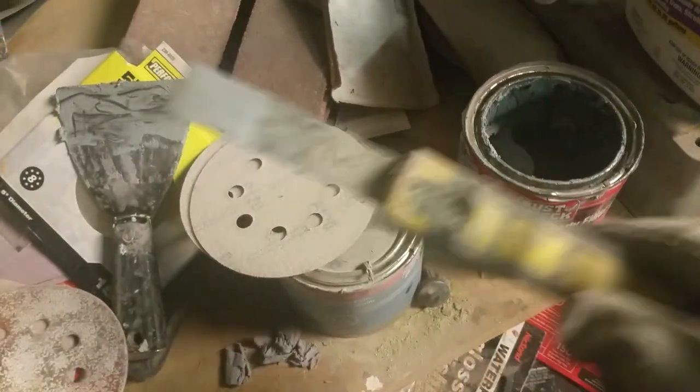Time to put a topper coat on the panel to smooth things out. I've got some filler started — just coming across with it, nice and smooth, to fill in the low spots. Here's how you do it: get body filler and the catalyst hardener. Slap it on and spread it like peanut butter — use the smaller spreader to dig it out, then the bigger one to mix and apply. Squeeze it out and mix it — it's not about amounts, it's about color and consistency. As you mix it, it'll turn really red; that means it'll dry in about five minutes.